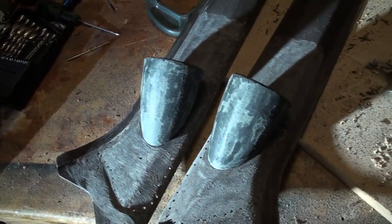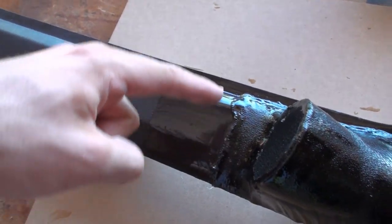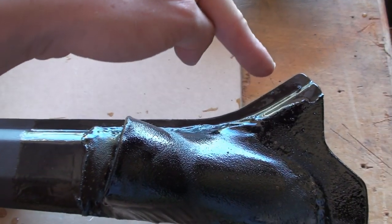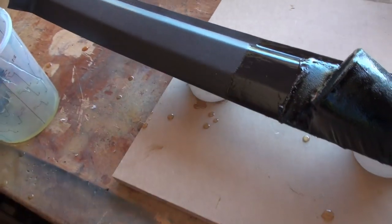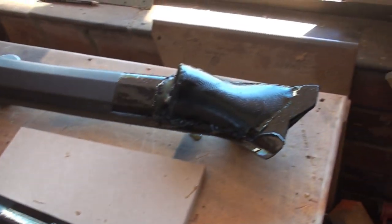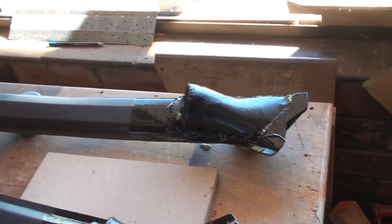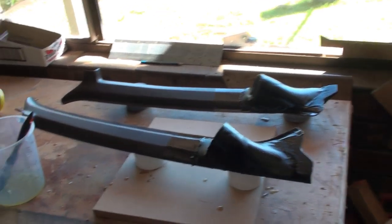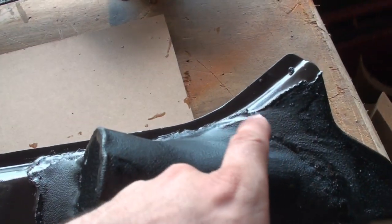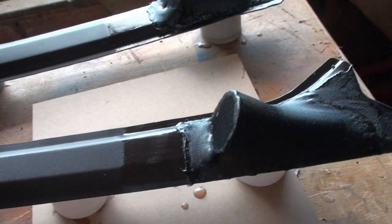I'm going to use hot glue to actually attach it all — just fiberglass. I trimmed the material like in there so I didn't go into that groove, trimmed it there. Obviously I'll body fill it, smooth. Same with that one — I did actually leave it go over the end. But there's a rough layer of glass on now, so obviously I'll body fill in little grooves and gaps — that's alright, I knew I'd have to do that. The Rage Gold is really simple to sand, so it's not a problem.